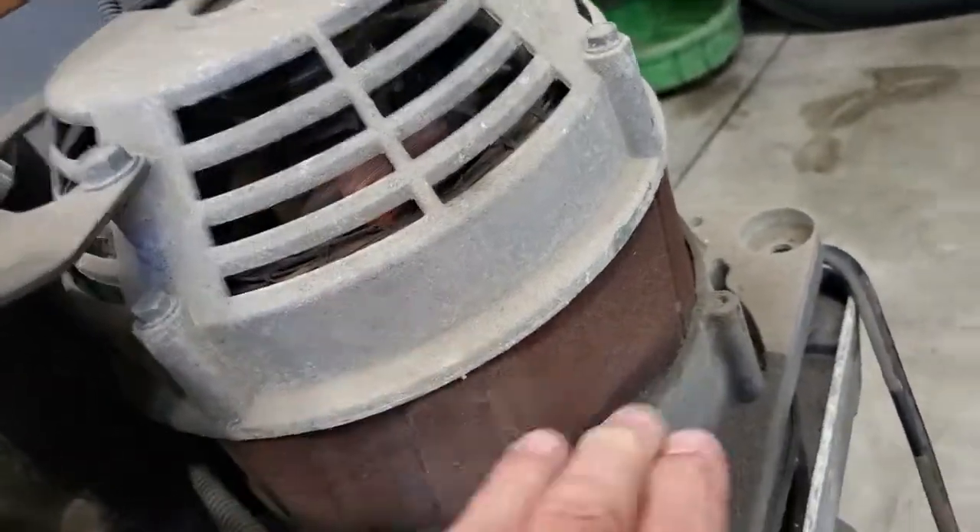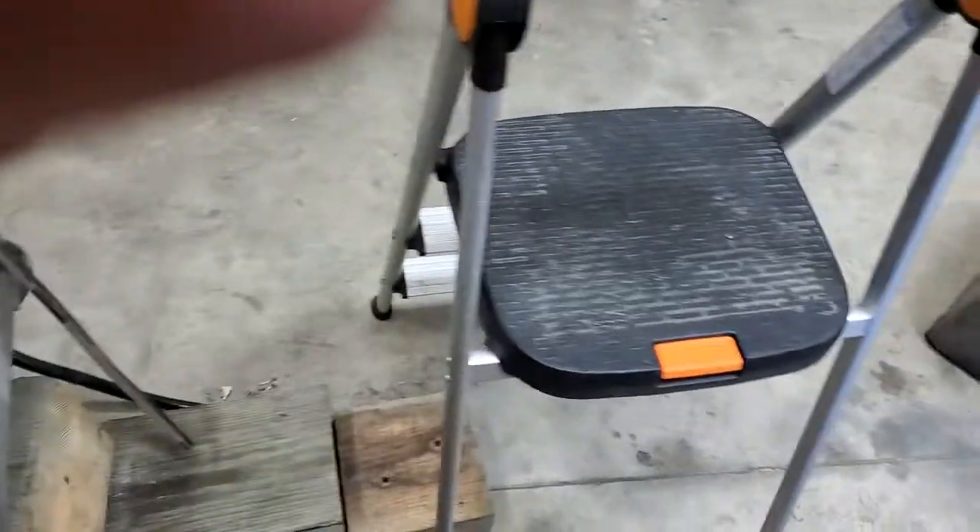This is the back of the engine - the crankshaft is right there. It goes through vertically. That's the rotor, this is the stator, rotor is inside. I'm going to blow this up so we can look inside at these slip rings. You see the white ring - right below it is a slip ring, it's all scarred up. Above the white is another slip ring. These two wires right here connect to it, and the brush set will come out. I'm going to take the brush set out and we're going to look at it later.